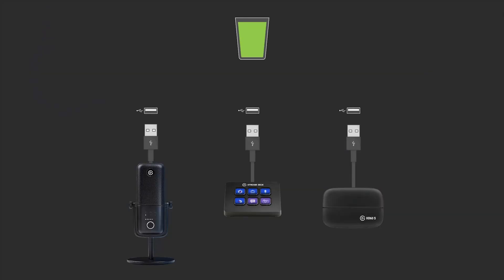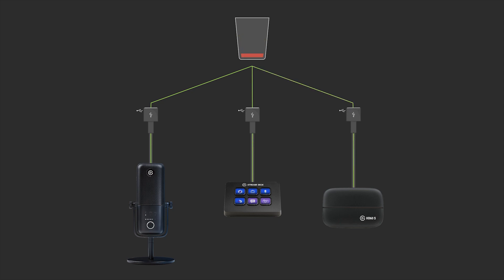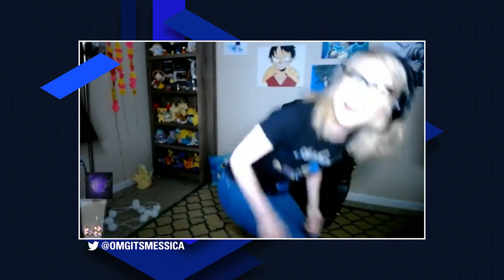This is because USB ports on computers generally have shared USB controllers. These USB controllers are what dictates the max bandwidth of the USB. So while a USB 3 controller might have a theoretical max bandwidth of 5 gigabits per second, if it's connected to 3 or 4 USB ports, they're all dipping into that total 5 gigabits of bandwidth. And if you have devices plugged in that collectively exceed the bandwidth of that controller, this is where you run into issues. You might have experienced this where a webcam has stuttering video, or maybe one of your devices just isn't showing up in your device manager.